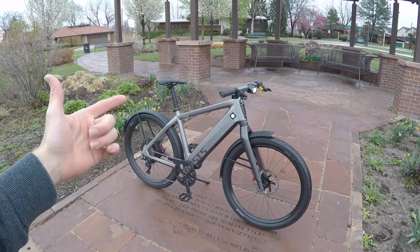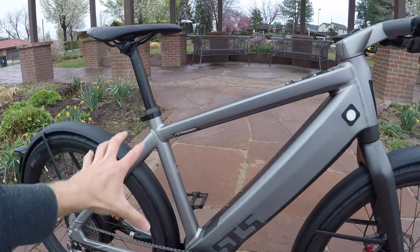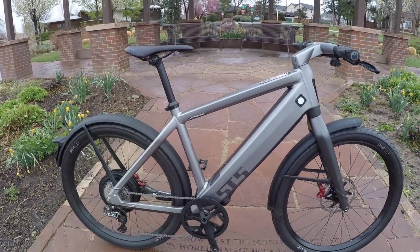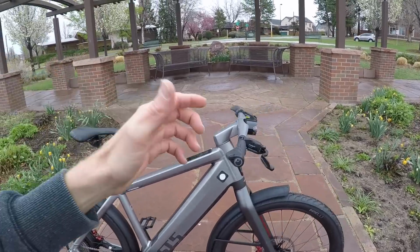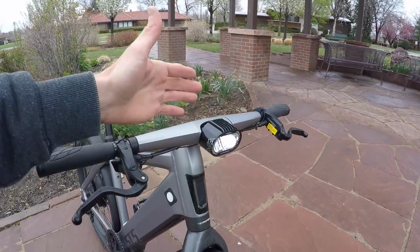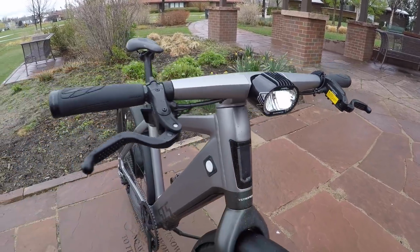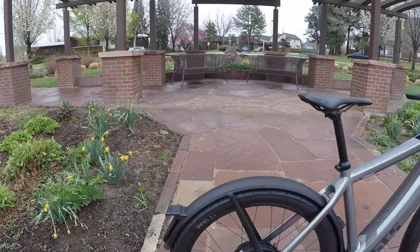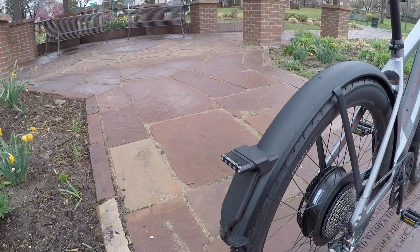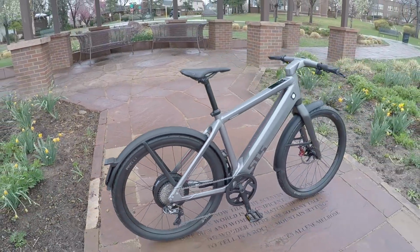This is a class 3 speed pedelec. Don't you want to be safe? Like, is any of the paint reflective? And no, it didn't really seem like it, even though it's a little bit metallic. It looks nice. It does have a super bright 1250 lumen Supernova M99, and it's also got this signature LED up here, but from the side, they're not super visible. And then in the rear, 5 LEDs. This is M99 as well, and there's a little license plate holder for people who are in Europe where there's different legislation around class 3.